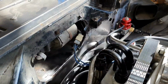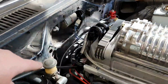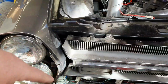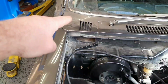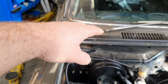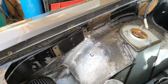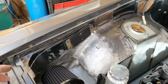Windscreen wiper motor wiring. Now normally this would have come from this point here. And it would come across the engine bay like this. And it would have gone along here. I think I explained this in the previous video. Out through the hole in the front. Down here somewhere. Back up into the guard. Inside the guard. All the way along there, through the side panel, above where your feet go, into the instrument cluster and fuse box area and all that sort of carry on. And behind here is a little electric motor controller unit that controls the speed of the windscreen wiper motors. I'm not kidding you, that's how they did it back in the day.